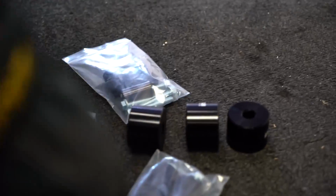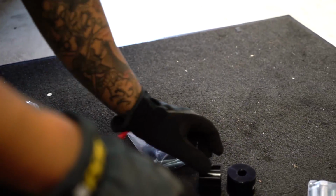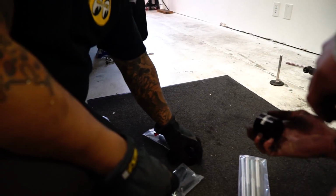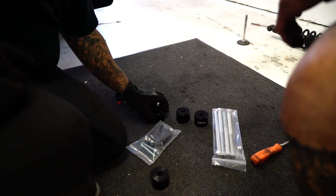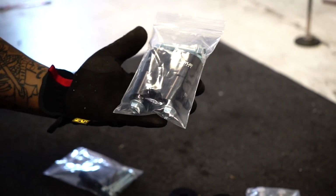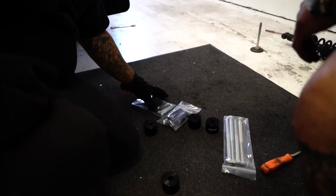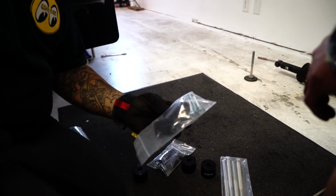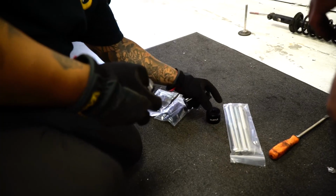Where are these for? These are for the rear subframe. These big ones here. There's 4 parts of the subframe where they mount to on the car chassis, and these go into the front bracket that goes from the subframe bracket to the car chassis. This is also a bracket too, same subframe. A lot of bracket and bracing, well engineered Subarus.